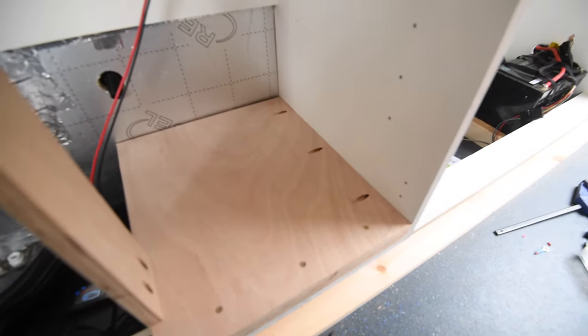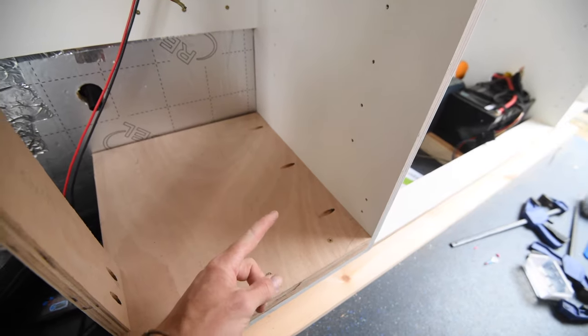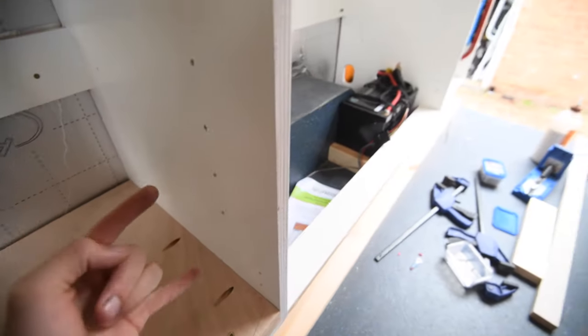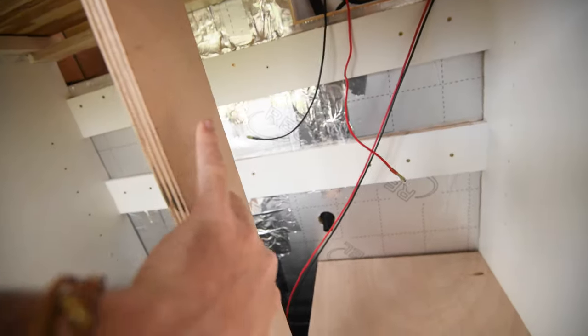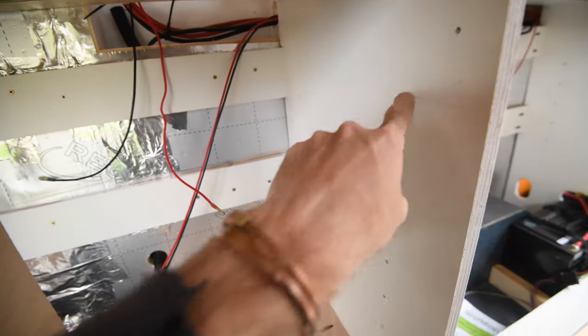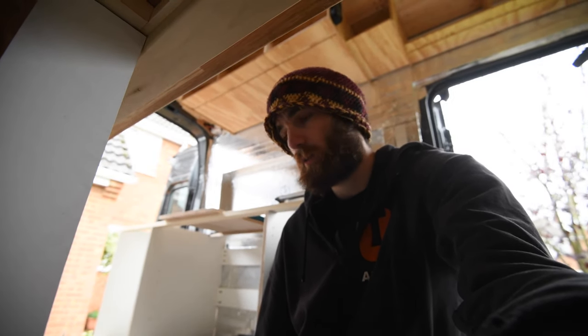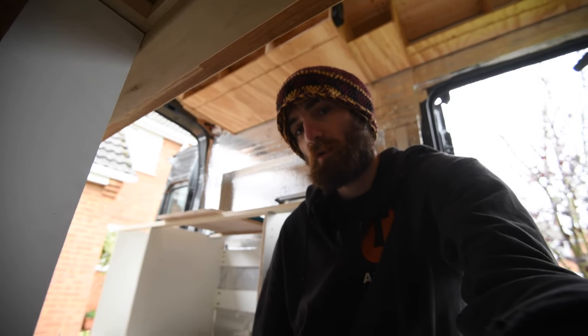At the minute it sits on 18mm ply screwed down here, and this support joins up to the frame. Inside the fridge there are holes you can drill from the inside to permanently fix it. I'll probably run a batten across the top to seal it off at the back. It is sitting above the diesel heater but there's a reasonable air gap underneath. Worth noting: it's a 12-volt compressor fridge, not a gas fridge, so it doesn't need external ventilation out of the back — it just needs a bit of clearance, which it has.